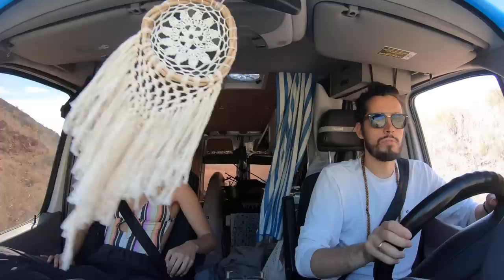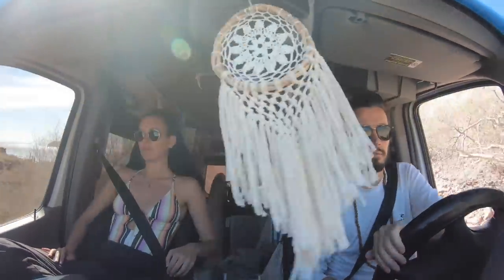A big problem with Sprinter van conversions is the suspension. Because you're adding extra weight to the back, it's very tippy — the suspension is too soft for the weight. I heard about a company called Agile Offroad in San Diego and investigated, but it's like six thousand dollars to upgrade with their fancy custom RIP kit. I did more research, called a local shop, and they said that by adding an extra leaf spring to the back, you can really firm it up.